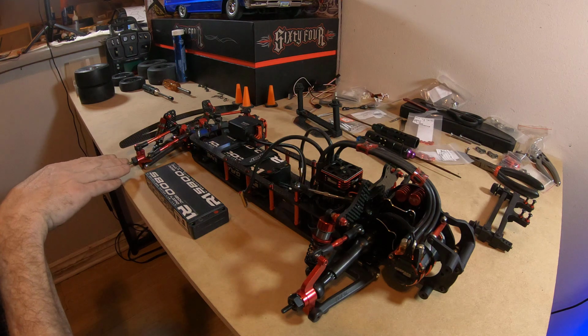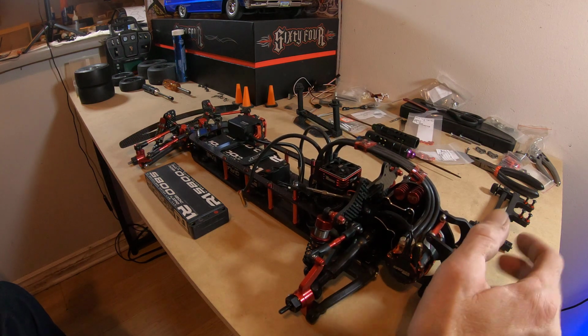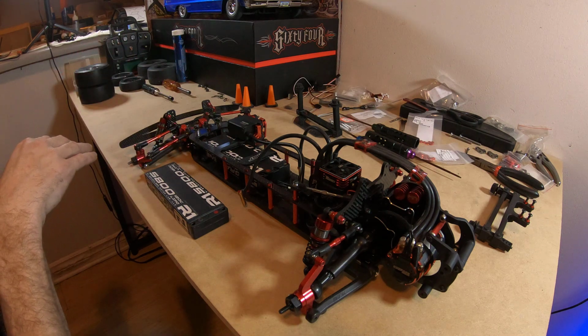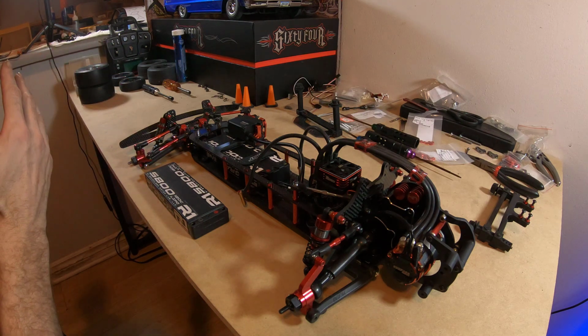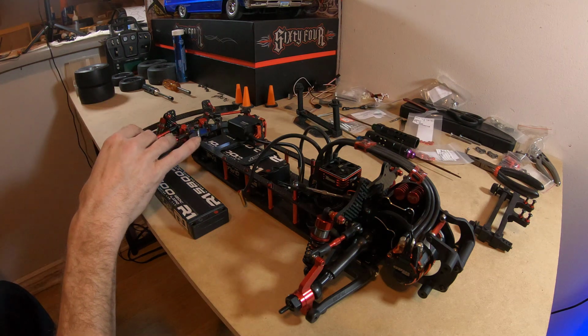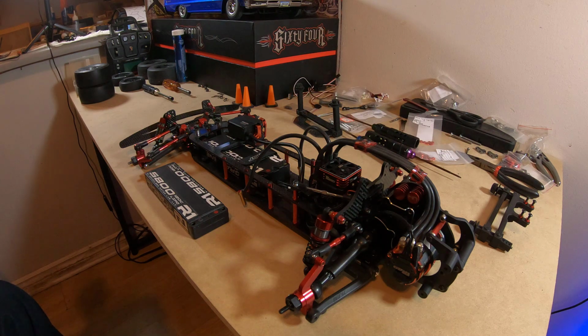The only kicker to this is because it's zero, and there's usually a little bit of forward rake, my suggestion is always to have at least 1 or 2 degrees of static camber, so that because of the rake, when you make a steering correction, it's not putting a positive camber dynamically on the wheels. A little bit of static camber will make sure that it doesn't do that.